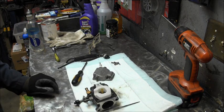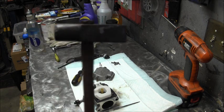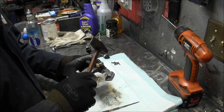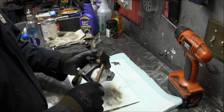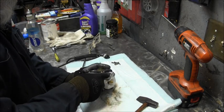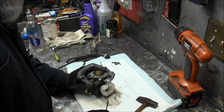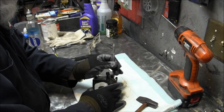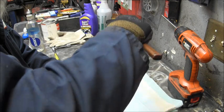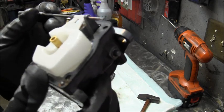Yep. Where you have to take a little tapping hammer. Because they have like, what do you call them? Little grooves. Splines. Tap, tap, tap, tap, tap, tap. Very gentle. See, it's coming. It's coming out. Oh, I can see them. Them little groovies. It's groovy, man. It's kind of rounded on this end, so it's going to be hard. Look at that. First shot. See them little grooves?